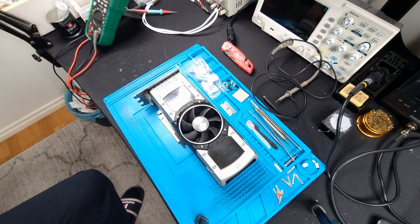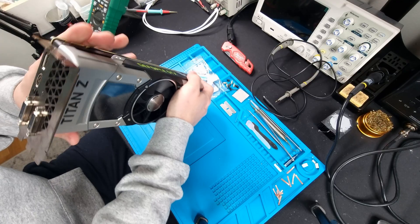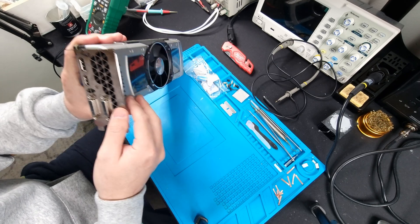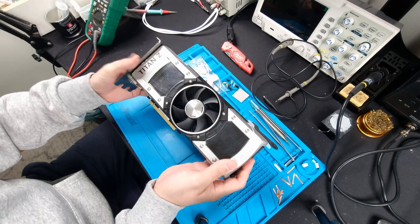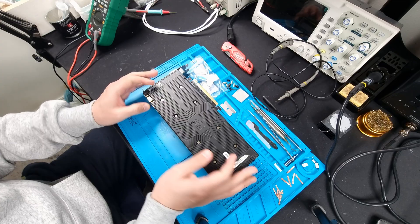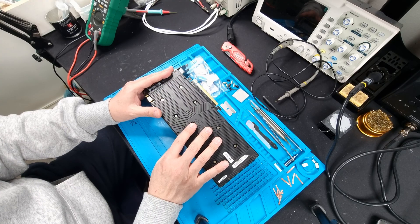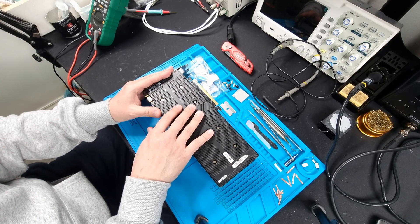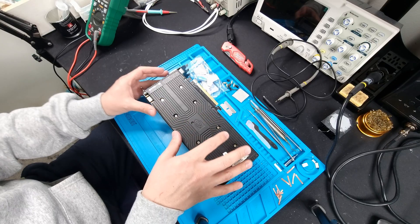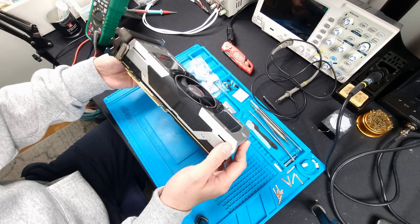Basically, what the customer is saying is that the card apparently has no display. DisplayPort doesn't work, but that's not why it's here — we only have HDMI that works. The customer said the card works, it turns on, it's recognized in Windows and in the BIOS, but it's recognized only as a default display output. It doesn't allow the driver to kick in, and after a while, when the driver does kick in, it basically crashes. So let's go ahead and run it through the paces and see what's going on.